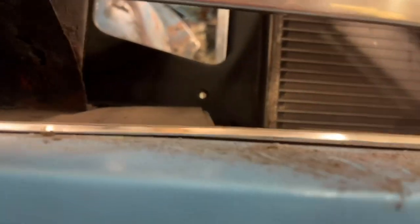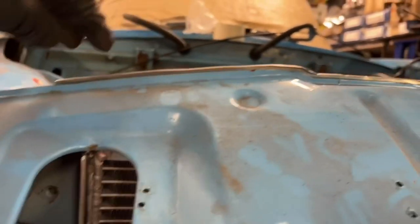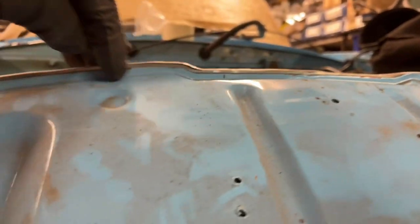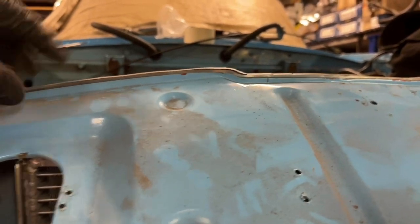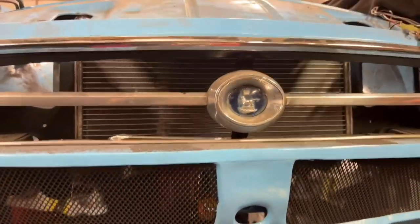You can see from the front where we've flagged it on the original Sunbeam without cutting the body away from where the radiator went - that's just nice. I've also put a top piece on the radiator to finish it off and trap the air, forcing it all into the radiator. We're going to do some aluminium scoop mods to get full air into it - I want this to run cool.